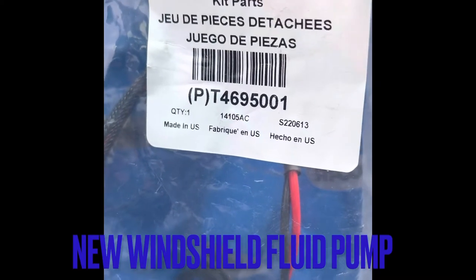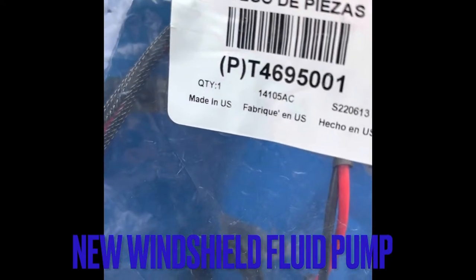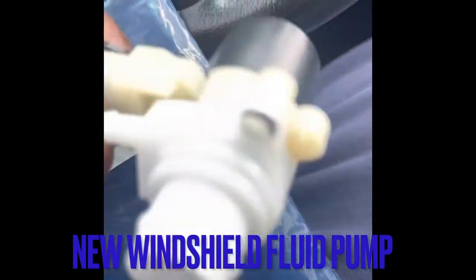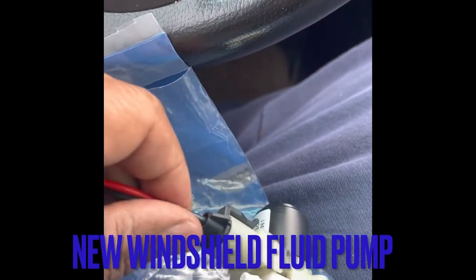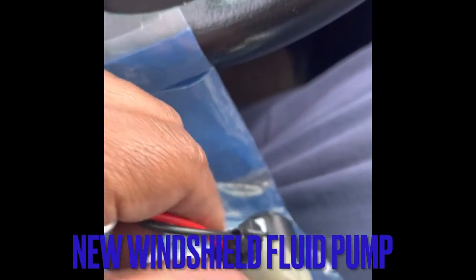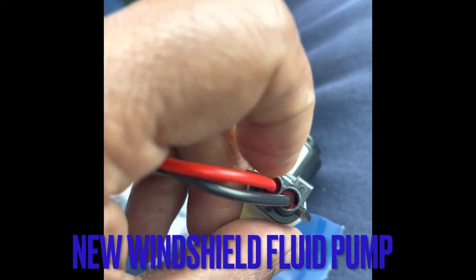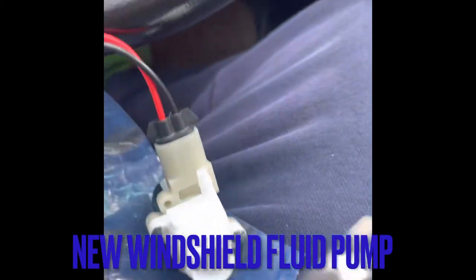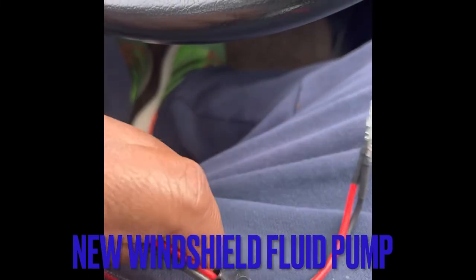So that's what I'm going to do later. But now, that's the part number right there: PT4695001. It's made in the U.S. — it's a Packard part, it's going for Packard. Now this is the trick: when you buy this, it does not come with this wire. So it doesn't come with the wire. What it comes with is this clip here, it comes with two connectors inside of here, and it comes with these little plastic things that you got to stick in there for the installation of the rubber. This wire right here came off one of my LED sets for the headlights — that's where I got the wire from — but you got to buy this separate.